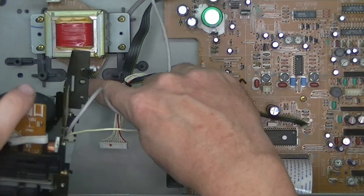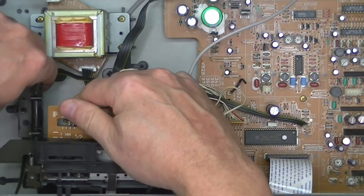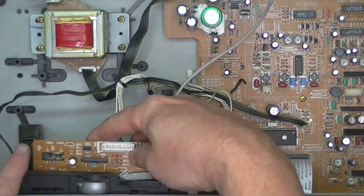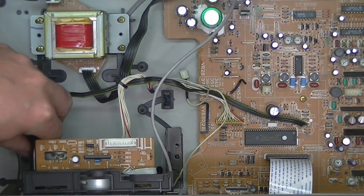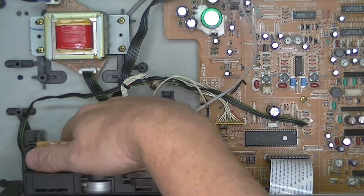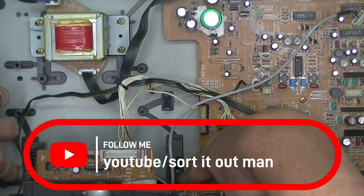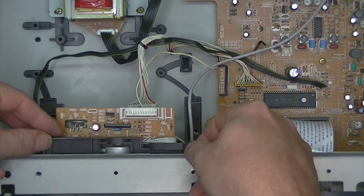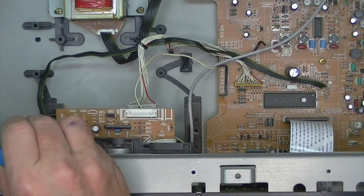Now let's pop this back in. Make sure you pull that cable well away from the eject flap. You'll see there are some little nodules there just to line everything up. You'll see it bind up on that back module and then you've got a screw hole showing on both sides — these line up so you'll know when everything's aligned because the holes are lining up here as well. Just to recap: that locating tab won't be on the first hole on both sides.